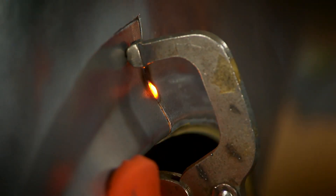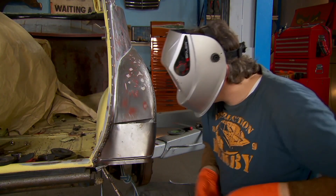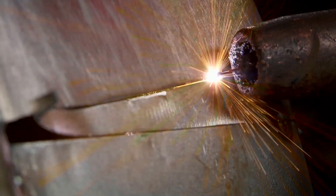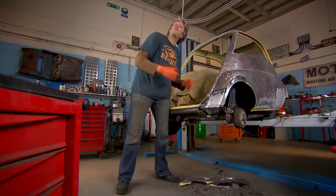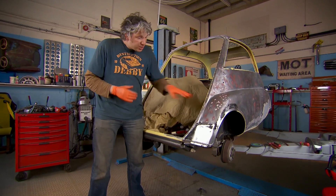At last I can get on with the job I set out to do so long ago. With the priming complete, I weld the arch on first and then the lower panel. Last piece of the jigsaw — this little repair here — and then the job is nearly done. I spot weld the key structural points on the panels, clean the welds, and I've got the Isetta looking half decent again. This job was supposed to take a couple of hours but it's turned into a two-day marathon, for which a panel beater would want several hundreds of pounds.